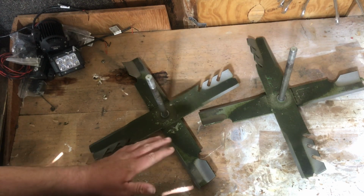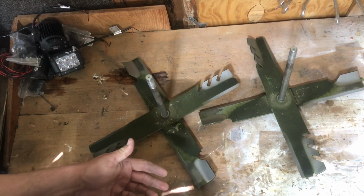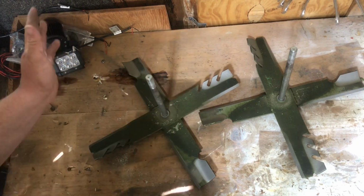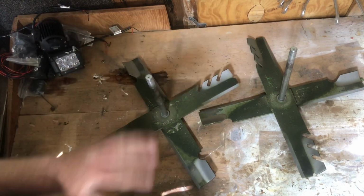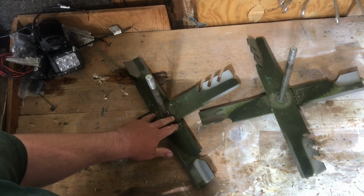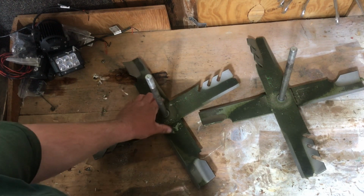So it is way less. There are customers that I have that I would cut their lawn every 2 weeks, and after each cut, I would have to go back through the lawn and disperse the clippings with the blower, just because there's so many of them, and you just want to spread them out. I don't have to do that with these. There are bi-weekly lawns that I had to double cut. When these blades are on there, I don't have to do that.